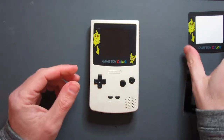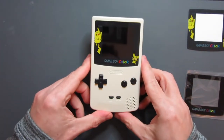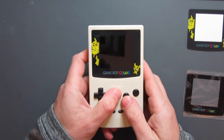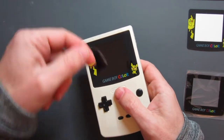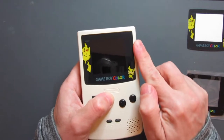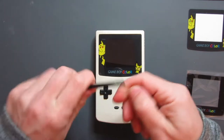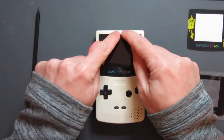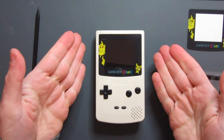If I end up doing it and change my mind, I've even got a spare of the Pokemon lens, so there's no worries. In terms of removing it, the temptation might be to try and find something to fit down the edge and lever it up. The problem is, although this is a plastic lens, this plastic is softer - so if you put anything down there, even something relatively soft like the flat edge on a spudger, you're going to cut into the bit around the frame and you'll always see that. So you want to keep it as neat as you can.